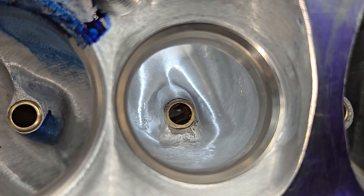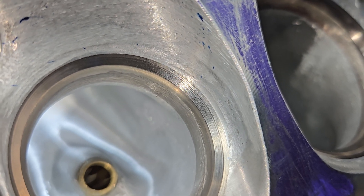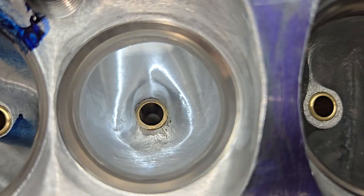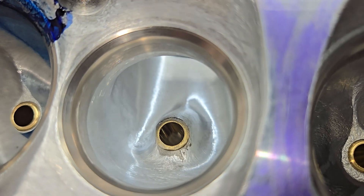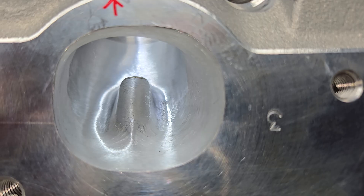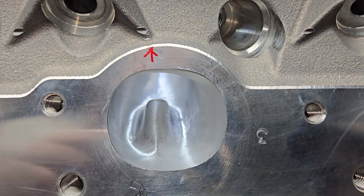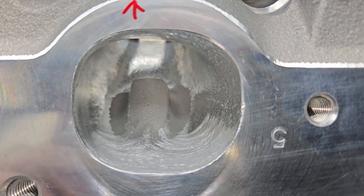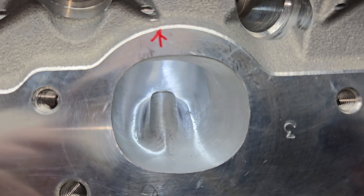On the exhaust, like I said, he opened up the throat a little bit. You can see exactly where he blended it into the radius. Dart likes to use a radius on their exhaust - I completely agree. Charlie did a nice job all around that port. The exhaust has a cartridge roll finish - looks real good. The LS3 exhaust port is nice, it's a little big, but Charlie did not make it bigger than stock. In fact, he's got a couple of them that were just barely cleaned up. We're going to pick the one that has the least amount of work and reflow those - that'll be the next video.